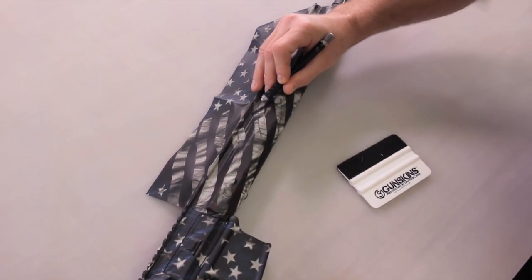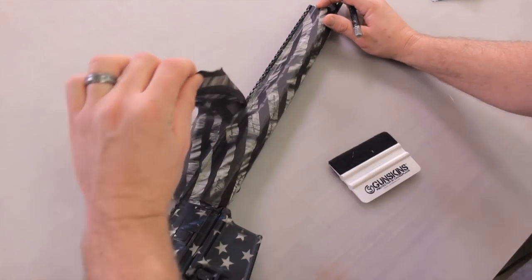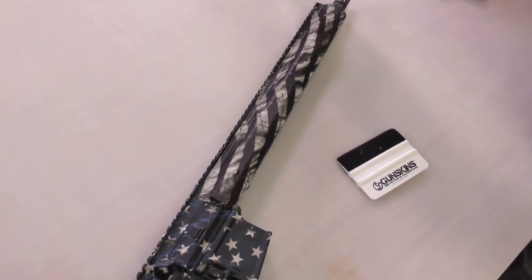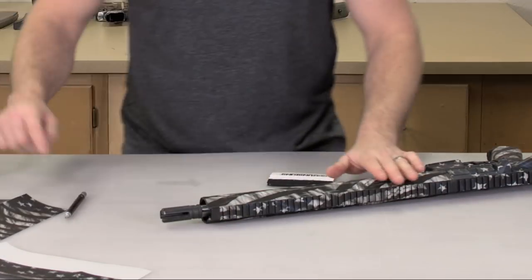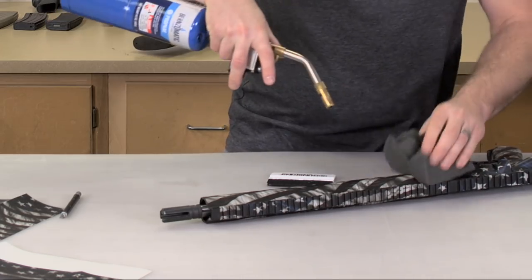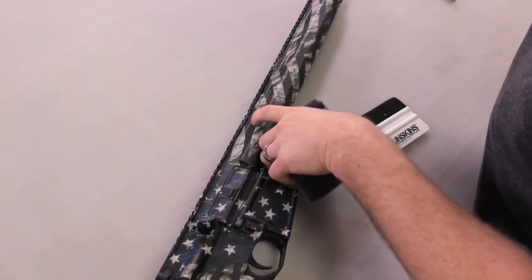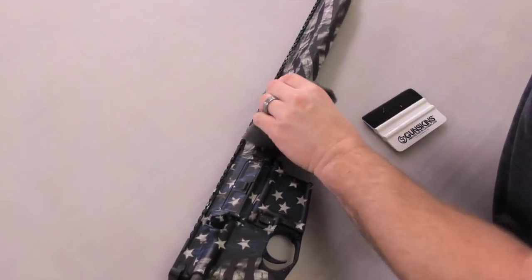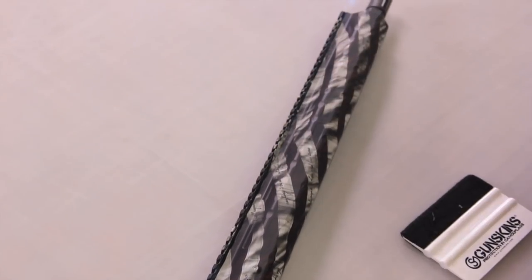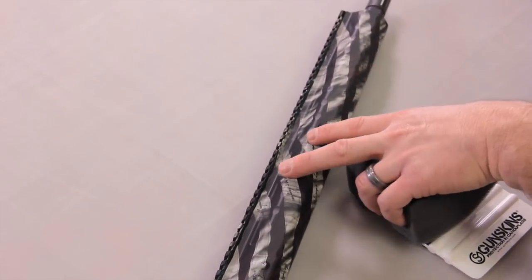I've worked the material around the top rail on the opposite side. Take the knife right in the corner there and follow that natural line to trim it loose. From here, start using the heat and the foam to work the material in. You can see how it presses down into the cutouts. Let it cool and then start trimming those out. That's important — use the heat to get the material where you want it, but allow it to cool before you start cutting. Otherwise it wants to stretch and pull and doesn't cut clean.